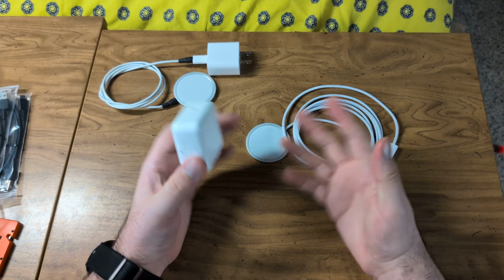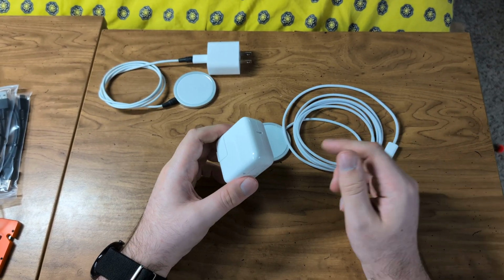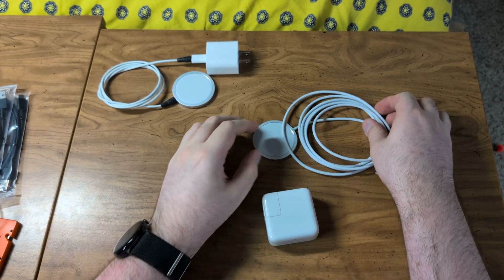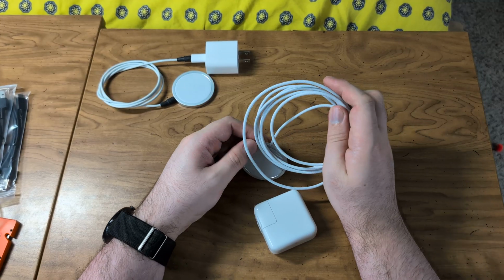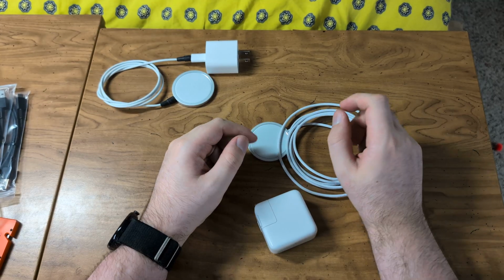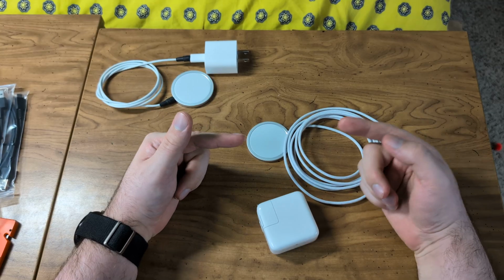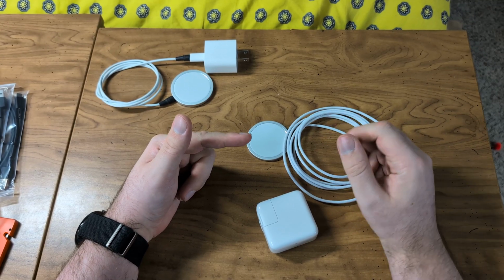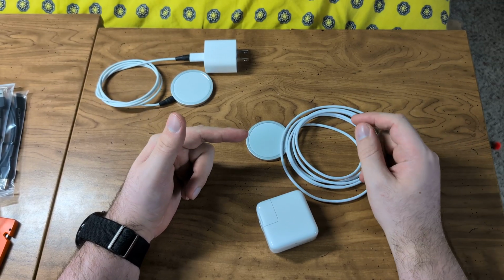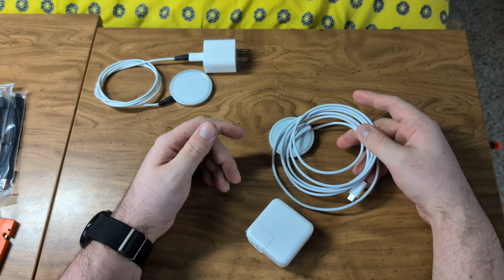You'd think they would though, because gaming laptops, that's where their AC adapters are at, but no, they still use the stupid barrel jacks. I'm guessing they don't want to pay for the cost of the PD and the chonkiness of it. I have some cables that are capable of 240 watts over USB-C, and the amount of chonk those have. The companies can just go 2 wires with their barrel plug, because that's basically a tip and an outer ring, tip and ring. That's 2 wires. They just need 2 chonk wires instead of what's in USB-C.